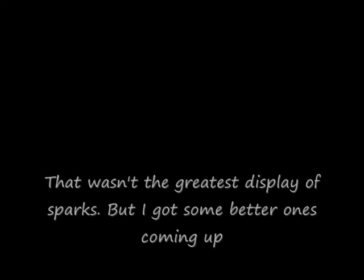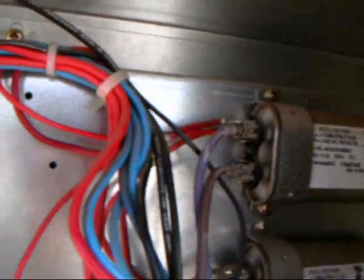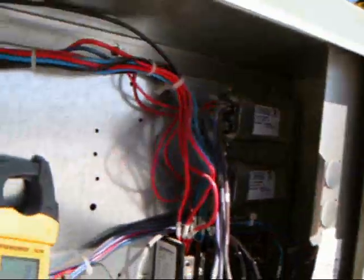Okay, that was a good one. Like I said, normal operation - the unit's working, you're just turning it off to service it. If you want, you can come in here and put the screwdriver across these capacitors, if you're just scared or whatever. But generally, you don't need to do that, because it's going to be discharged through the motor windings.